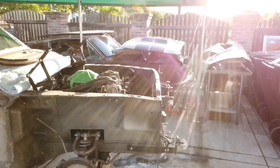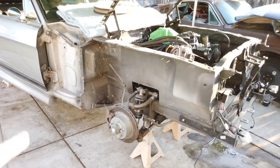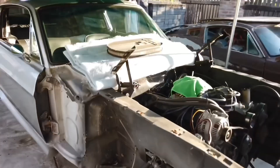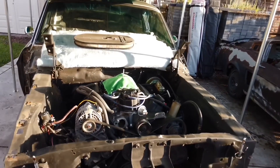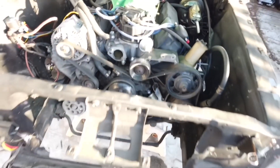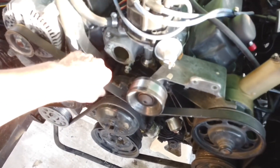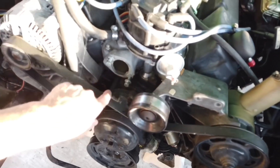On the front, the fenders were welded shut to the bottom, so I had to wiggle them and that broke off the weld. I decided to take off the hood as well because I want to clean this engine bay — make it nice and fresh, redo all the wirings and hoses. I ended up removing the radiator because it was leaking on the bottom hose, and the neck with the thermostat was leaking too, so I'll have to redo that section with a new gasket.